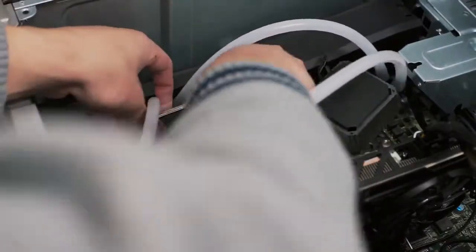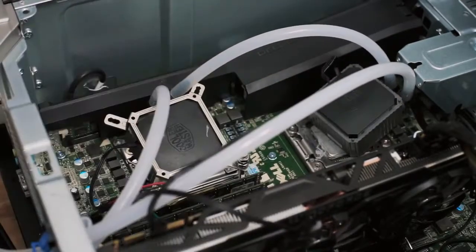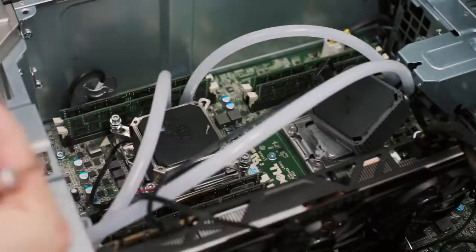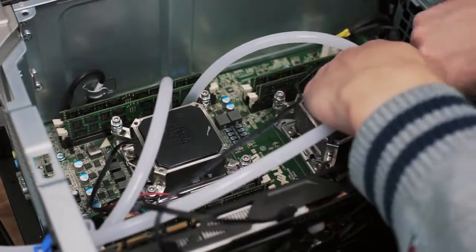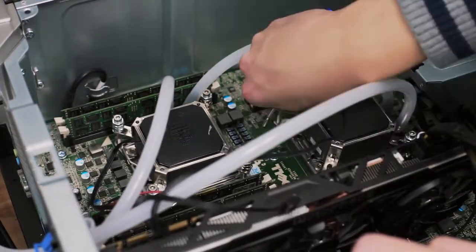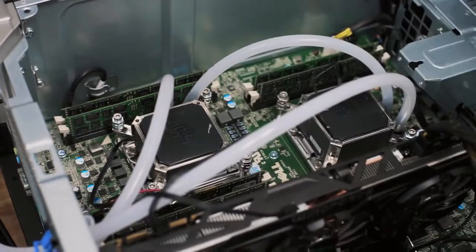With the coolant pipes in place, all that's left to do is reinstall the water blocks to the processors, with a bit of thermal paste under each. I'm just using some cheap GD900 brand stuff from China, which was actually an excellent deal and works surprisingly well. I tightened the screws by hand first, and then tensioned them a little with the screwdriver. Make sure you don't tighten them down too tight though, otherwise you'll damage the socket. Just tight enough that there's reasonable resistance to movement. That's enough.